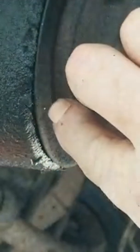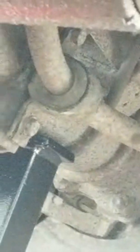So, yeah, right there is the pinion seal. This is something I've done. The pinion seal is so bad. It actually moves. This is the seal, and it's supposed to be locked to here to keep the oil from coming out through this little hole here, or this seam. And you can see it's been leaking out pretty good from underneath there. It's been dripping down.